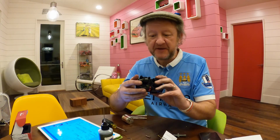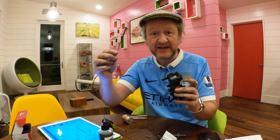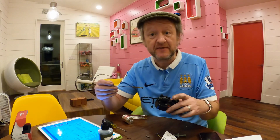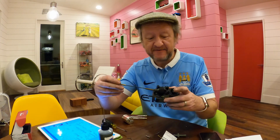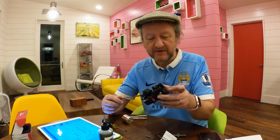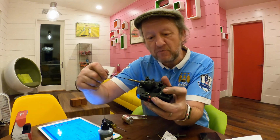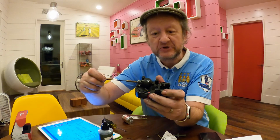Okay, I've got the rear gearbox done, and once again to check it, I'll take my handy dandy four-wheel drive shaft of the Hotshot, and I'll put it in the back here, which is going to attach to the front transmission box. So I'll put it in here, and let's see if these go around. Oh yeah, that works out good. And on the other side, yep, it goes at the same rate as well. You can secondhand see it rotate here. And if I put my finger on one, the other one will move around just a little bit.